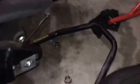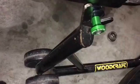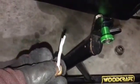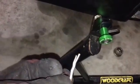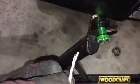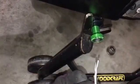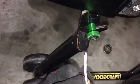And then we're going to go ahead and clamp our castle nut down to about 70 to 80 pounds. And then you should reuse your cotter pins. You should not reuse your cotter pins. Just replace them with the new one. Sometimes they are salvageable to where you can reuse them without them breaking, and it's okay to do so. Even though the manual says not to, it is going to do its job.